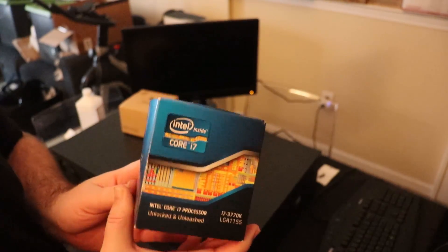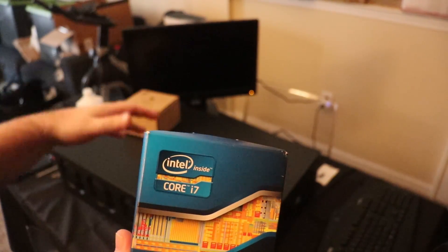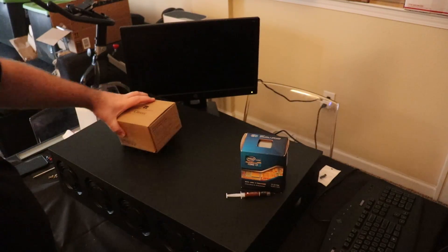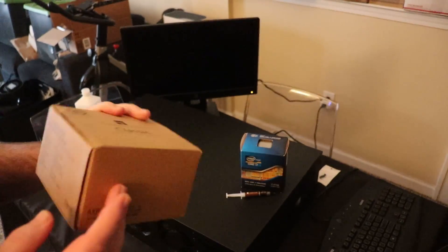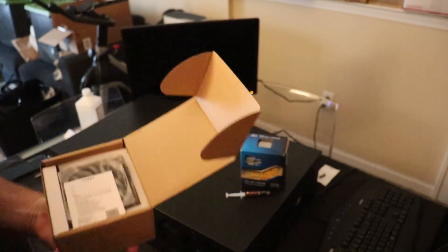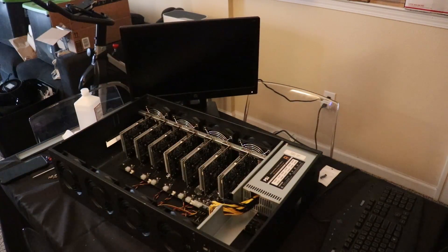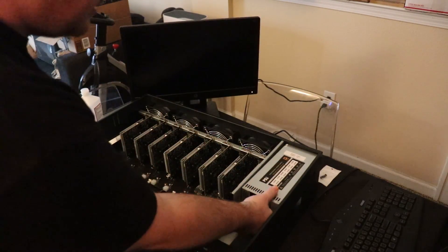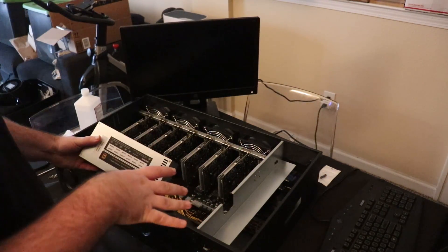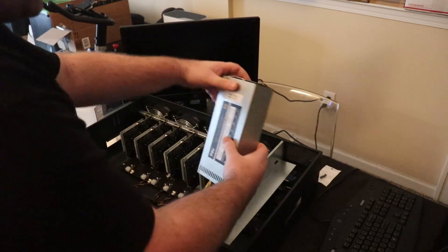The idea behind this was: let's take our GPU mining rig to the extreme. Let's throw the best processor we can in it without having to change out all the guts. We've got some Noctua NT-H1 thermal paste and the Thermalright AXP90X53 heat sink — this is a low-profile heat sink. We did have to go low profile because this section where the power supply goes has a bar, and the CPU sits right underneath it. So in order to put a decent heat sink on here, we needed to go with a low-profile design.